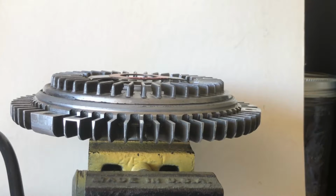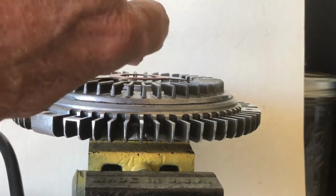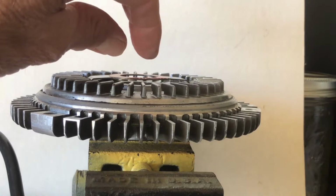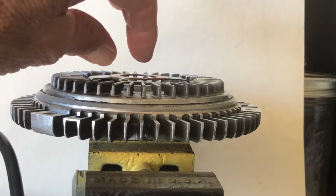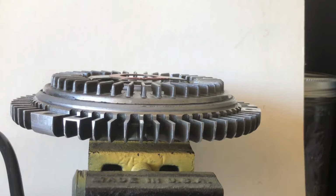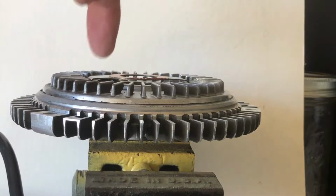So the theory is, these old timers that say, I've been doing it for 25 years to adjust those stupid things, is that they stick, I think, a big screwdriver through there, and they twist it and they bend this thing up a little bit so that when it does heat up, it'll heat up at, say, 90 Celsius. Now, adjusting that for 90 Celsius would have to be figured out, but there's really no way of testing because that pin is spring loaded.